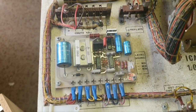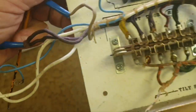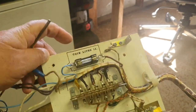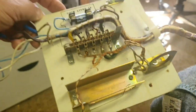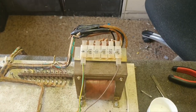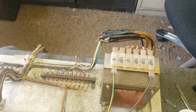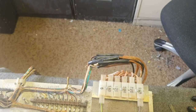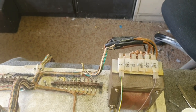Here's a closer look at the sound card — this became sort of common practice toward the end of the 1970s with electromechanical games. Here's the tilt mech; we've also replaced the fuse holder there. The ball tilt is all bent up and the tilt bob wasn't in it, so that's okay — it's home use only. The transformer is one of those where you can set it for different voltages: 240, 220, 200, 125, and 110. There's something here we need to investigate — someone's done something at some point, but it's probably all okay.